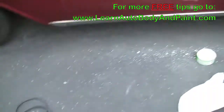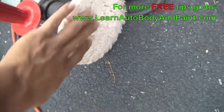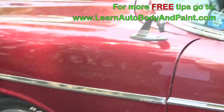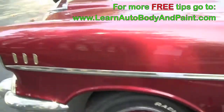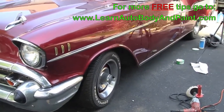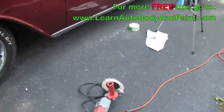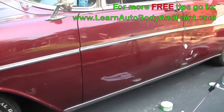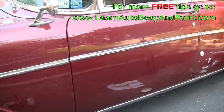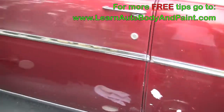So that's how you do it DIY style if you don't have a buffer — you can use a drill with one of these adapters for the little buffing pads. But I highly recommend, if you're going to be doing a complete project or doing something for a business, a buffer is going to cost you about $100 to $150 for a good high-quality one. Pick up a foam pad, a wool pad, and some good compound, and you'll be repairing scratches like nothing.